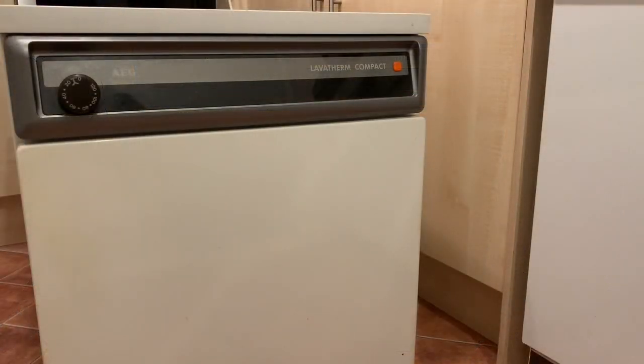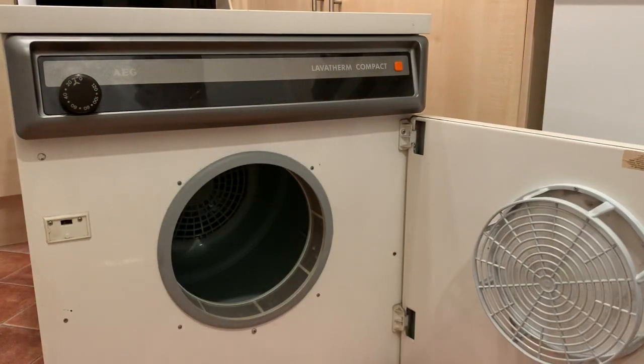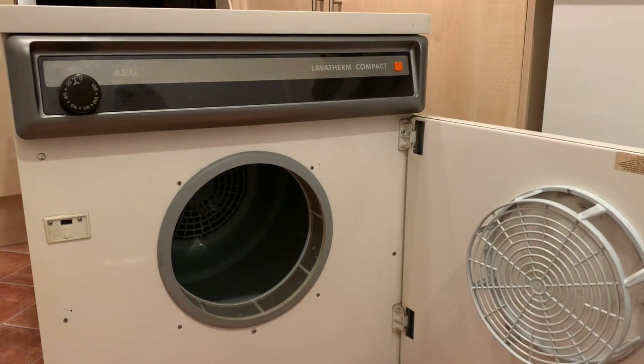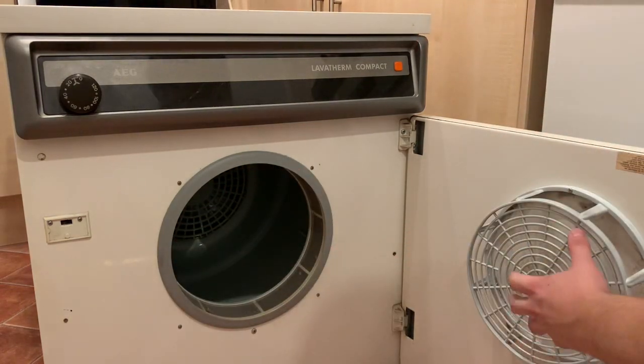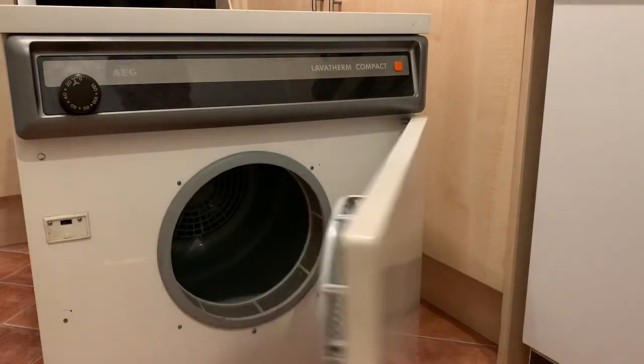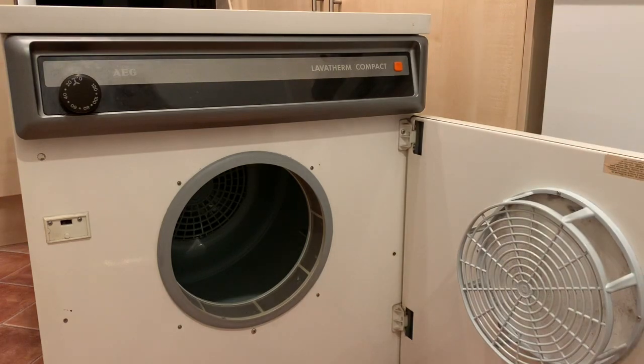The door opens with the hinge on the right. We've got the filter ring which goes around the front of the dryer with a plastic clip/push closure. The air then goes through a duct and out of a vent at the back. You can vent it from the back at the bottom right corner or on the right-hand side at the very back — so two venting options. At the back of the drum there's a fan, and there's a fan belt that goes up to the motor, which is mounted at the top right of the tumble dryer.